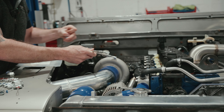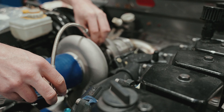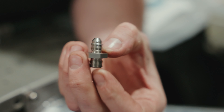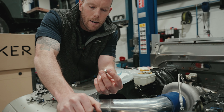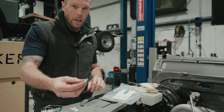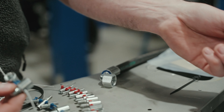We fitted a big Borg Warner turbo to an engine that didn't originally have it, so what I needed was a fitting that fit in the top with an AN3 fitting. We did the usual — had a quick look on the internet and found the fittings for the block. But as you know, manufacturers don't normally abide by the same spec time and time again. So when I went to fit it, I realized the fitting Joe had provided was wrong. I've just gone and done a comparison — put a tap inside there and figured out what it is.